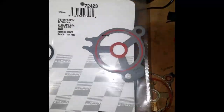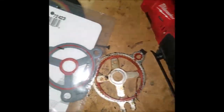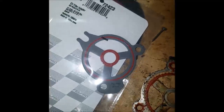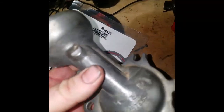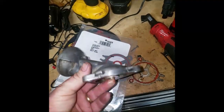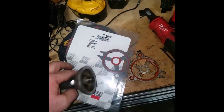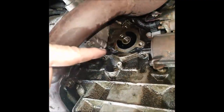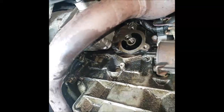I got back from the auto parts store and got the new gasket. You can see it's got the seal around the middle — this is gone on the old one. I went ahead and cleaned this housing up, put it on the wire wheel, used brake cleaner, so that if it's leaking again later you can double-check and tell more easily if you've got a new leak. It's always good to clean these up — clean the mating surfaces before you put it back on. I also cleaned up the block surface real good.